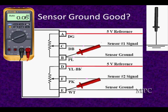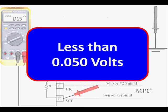If it doesn't go low enough, it's the ground. We say a good spec is under 50 millivolts — 0.050 volts. That's not going to cause a problem, and good cars are all under 50 millivolts signal back to battery negative. If you're working an intermittent and it's higher than this, you may have an intermittent ground.